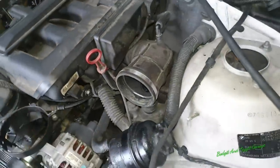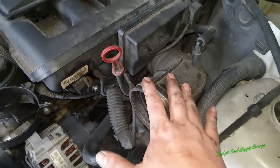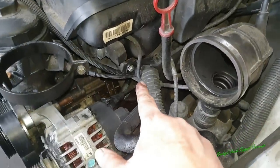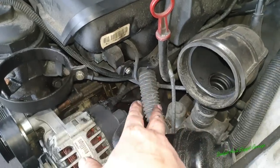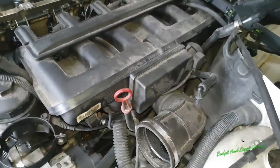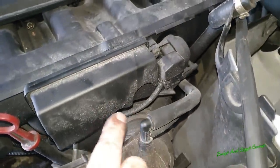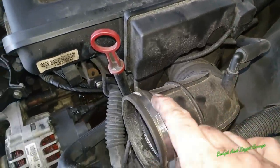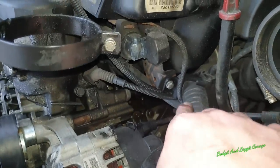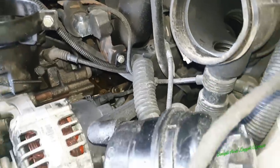What I am going to do is start stripping a few more things this side, because we've got another bolt under here we have to strip. We've got the air intake pipe, we've got the dipstick, there's a power distribution board there as well, or connection should I say, that we've got to take off before we actually take off that, and then we can get this intake manifold off. But again, I'm not gonna be able to film this because as you can see, everything's really tight. I'm gonna have to be careful of all the vacuum lines and stuff, because the chances are the most we're gonna break as well. A few more sensors to disconnect from this power distribution here. But again, once I get a bit more off, I'll show you what I mean.